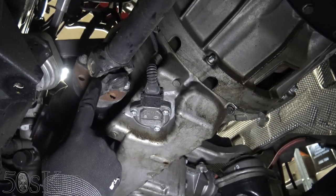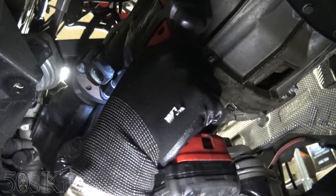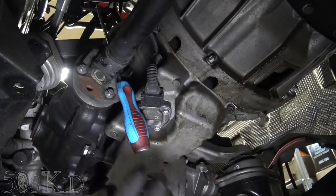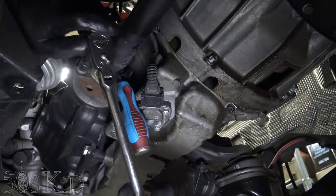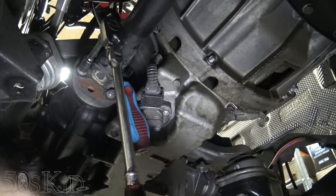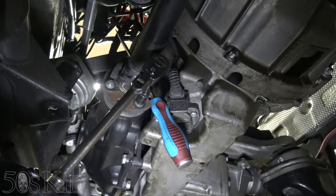Okay, we're gonna get this front drive shaft loose. And these are E12s. It doesn't like my extension, but I need that extension. Okay, so I'm thinking something like that. That's gonna stop the drive shaft from rotating. Come in here, give these a crack. Oh, these are really on. Yeah, okay, I can get both of these like that.